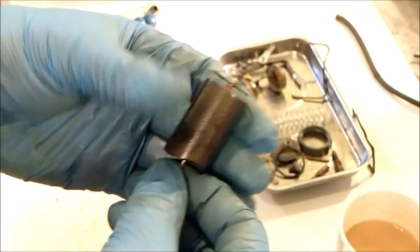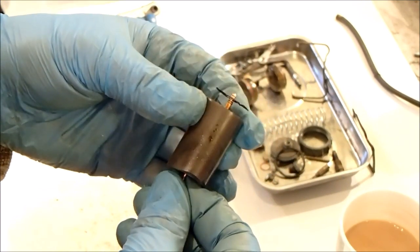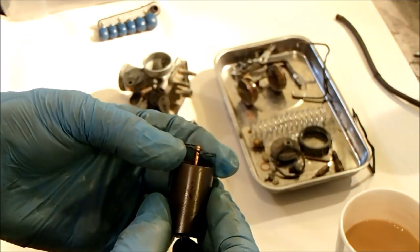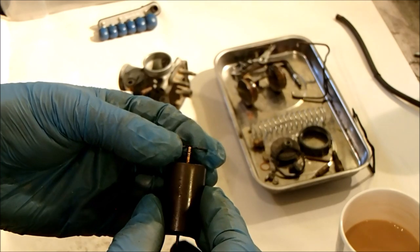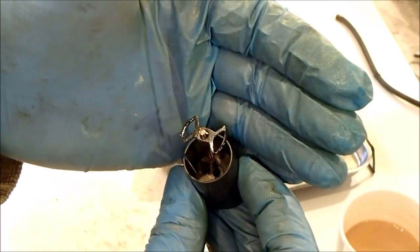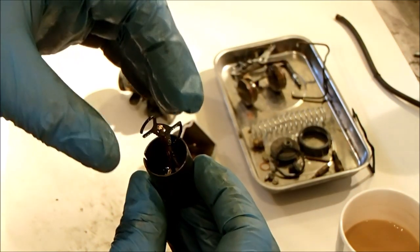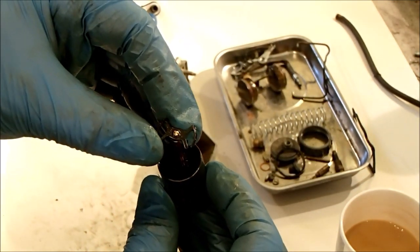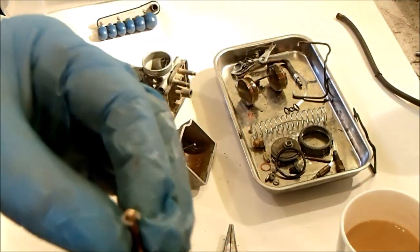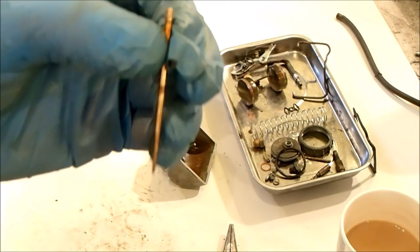Okay. I came to look at the needle as well, because obviously I want to throw this in for a clean. And the whole needle just pushes up from beneath. And it has this little widget on top. It's kind of that orientation, so it's got the two little cutouts at the front. I don't think it matters, I think they just act as a spring to add resistance. So that comes off, and that's steel, that part. And then the needle slides out.